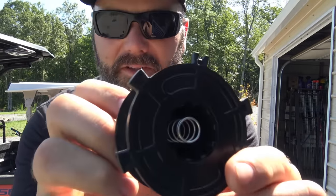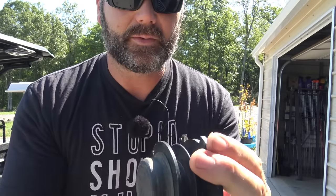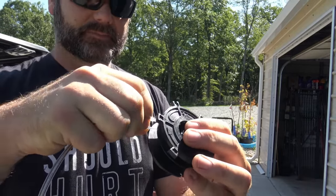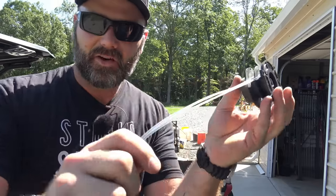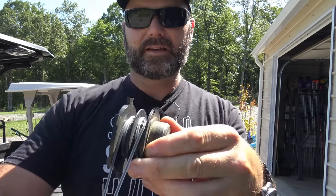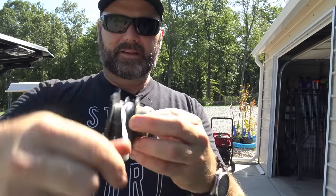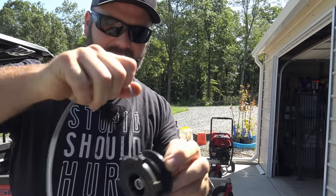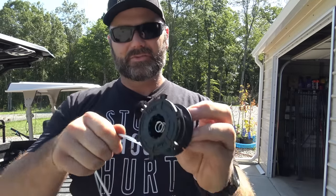Here's how we wind. Inside your little reel for your string trimmer, you'll have two holes. This will house one half of the string and this will house the other half — both strings will go around in the same direction. We insert our string trimmer string down into those little holes simply. We're going to go back on themselves — hold both strings in your hand and roll backwards. Just roll it right on there. You don't want them to cross up; just roll them right up on the reel. If you get all crossed up and twisted up, just restart. It should only take about two minutes to restring your weed eater versus that 20 or 30 minutes when it just turns into a Scooby Doo mystery.